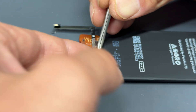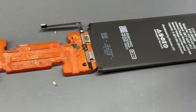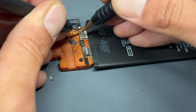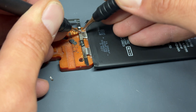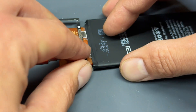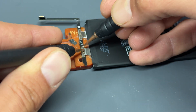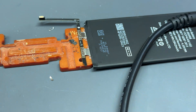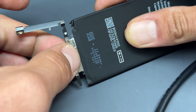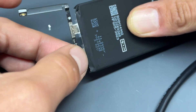Do the same now on the other side to secure the cathode into place. Once they're lined up, take our welding tool, apply a lot of pressure with one of the terminals on the battery welder, and secure it — try not to slip. Make sure there are plenty of welds for a good connection, then repeat on our other terminal — the cathode. This one usually sticks much better because it's nickel. We're just going to do a little pull test to make sure it's secured — that feels really good. I'm pulling quite hard and it's not going anywhere.